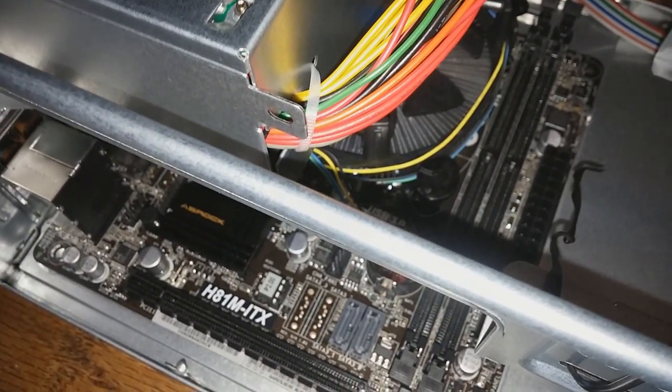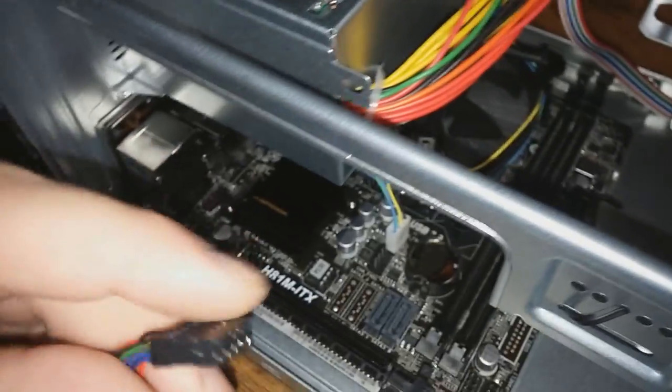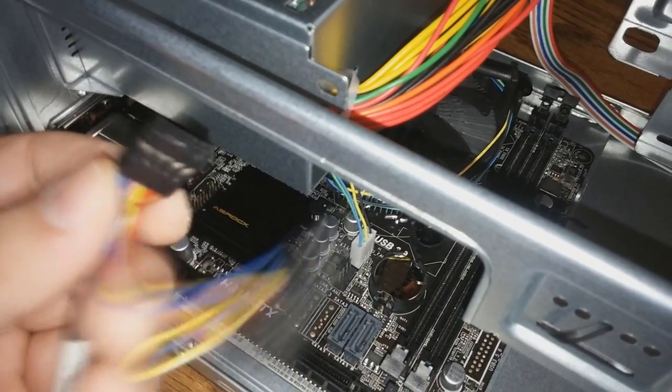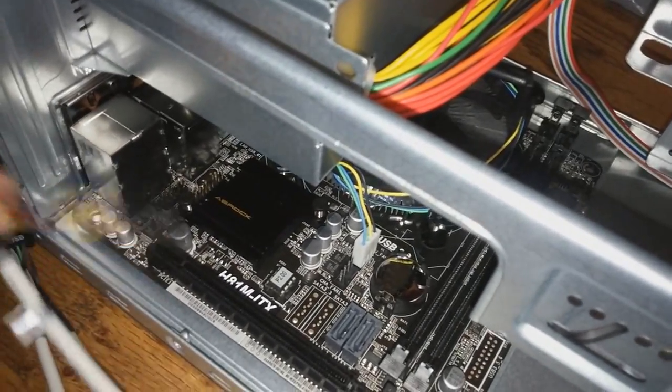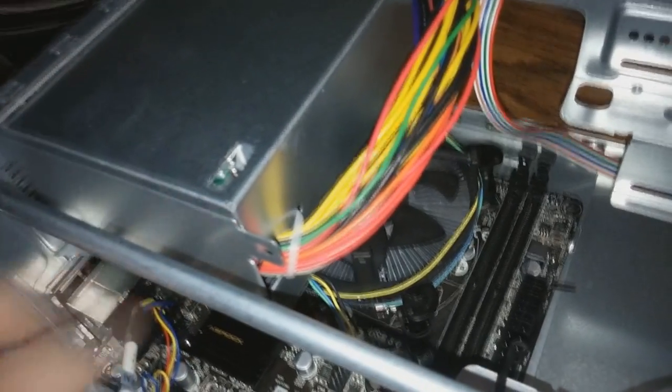Where is USB 2 audio? On the audio. There. Differentiating the right ports for all these is pretty easy. You can see there's a little blocked out hole for the HD audio. Probably you can cut off the AC97. It's actually completely useless because nothing uses AC97 anymore. It's really, really old. It's like 1990s old. So anyway, HD audio's got a little blocked out port. It only fits into one of these little pin spots. It does mark it on the motherboard. It should say HD audio on it. Just plug that in there. Good to go on that.